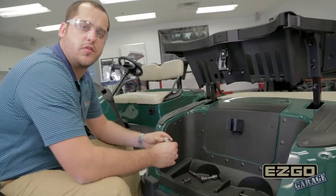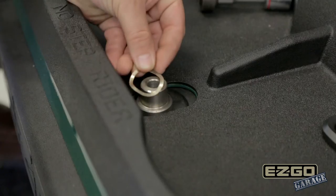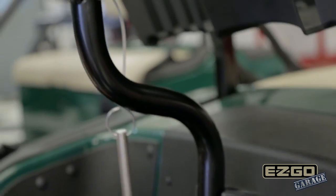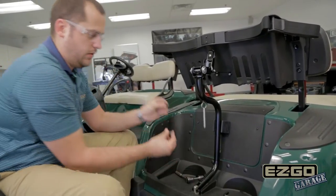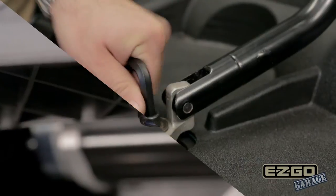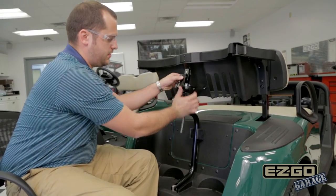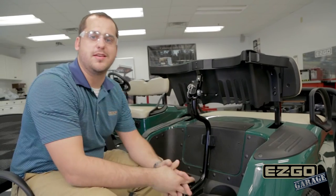To finish up the installation for the tow bar on the rear, we're going to go ahead and first insert the bushing through the hole in the floorboard. Make sure that we've got our wave washer on the bushing. Next, we're going to physically insert the tow bar. Put the bolt through, and then from the bottom side, make sure that we get the washer and the nut. Now that we have everything tightened up, we're going to snap the tow bar in place, insert the pin. Everything is good and tight. Let's move on to the front.